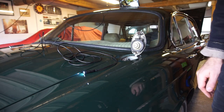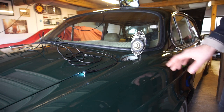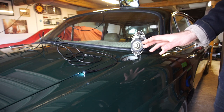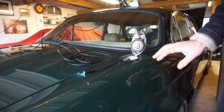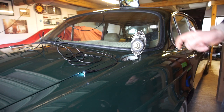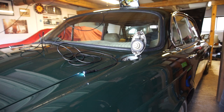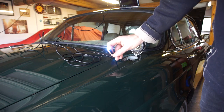This is the right-hand tank off my 1975 XJ6. Since I've had the car I've never used this tank. The previous owner told me it leaks — he was away on a long trip and noticed it was leaking, so they used up as much fuel as possible and switched over to the other tank. In a previous video where I disconnected this tank, it was completely bone dry. I think if there is a leak it's probably really far down, because the pump doesn't pick up all the way to the bottom — it picks up a little off the bottom and has a screen or small filter on it.